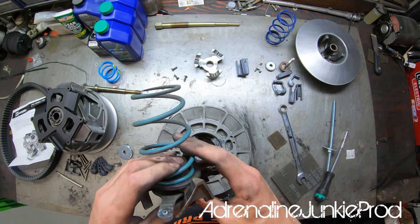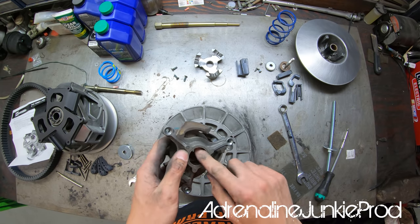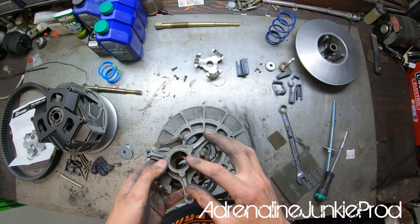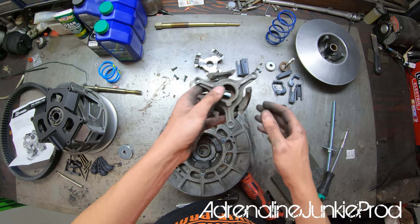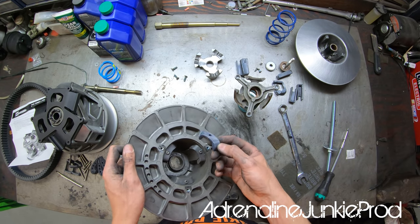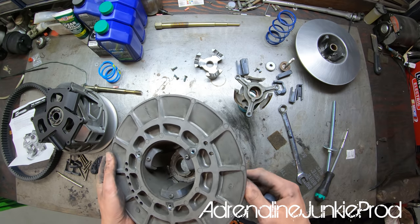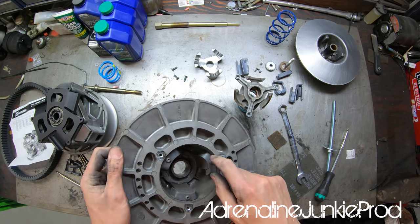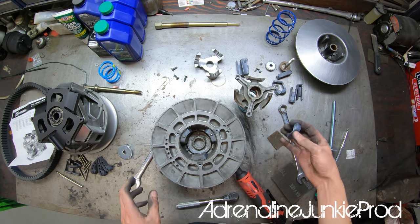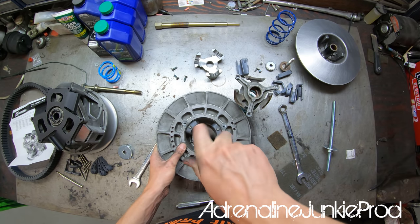Lift the assembly out — this is the secondary spring from Boondocker. Comparing it length-wise to the new AA spring, there's quite a difference. There's also a brass shim or retainer washer in there — I should probably replace that next time. There are more wear components in here too — these ones actually look pretty good still, but I'll replace them anyway since I'm putting new components in.